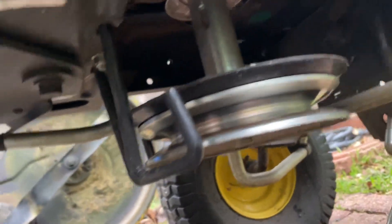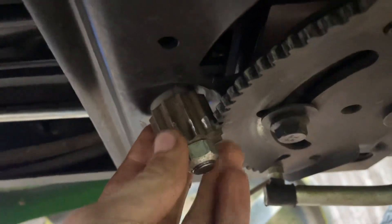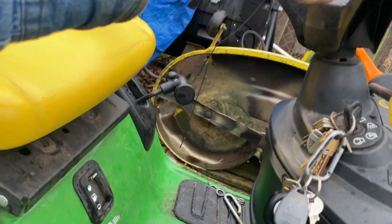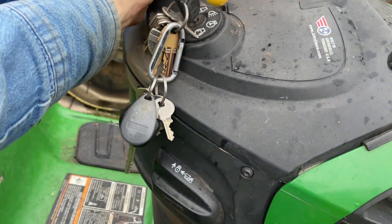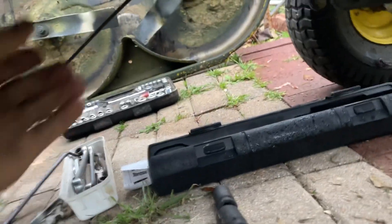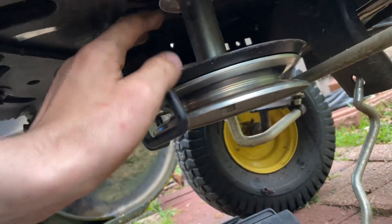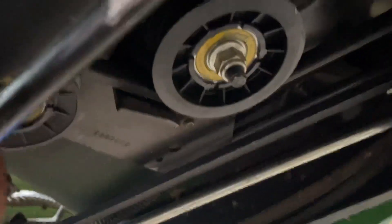You always have to make sure your wheels are centered. You have to take the steering gear down and then pull your steering wheel up, keeping it as straight as possible. Once you do that, you can get in there and pull the belt through, because the steering column runs right in the way of the belt.